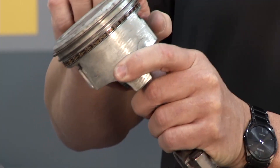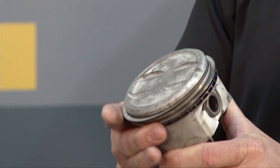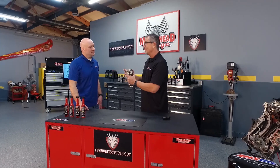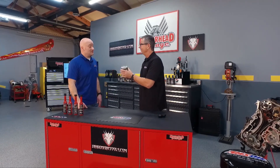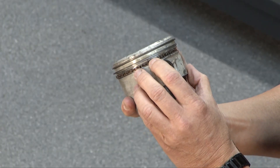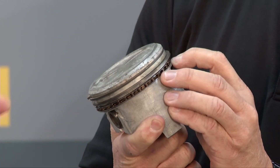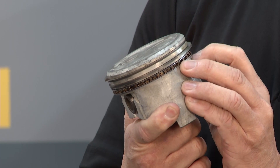Len from Amsoil — this is a lot going on here. We have some rings, compression rings. But this oil ring right here is supposed to scrape the cylinder and keep the oil from going up there. And if it's doing its job, you're not getting much lubrication, are you? That's exactly right. The piston rings are about sealing, and that oil ring is about scraping away any oil so you're not burning it and putting it through the catalyst system into the atmosphere. So if it's doing its job, it gets dry up there and wear can happen.